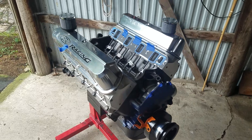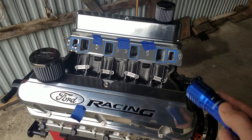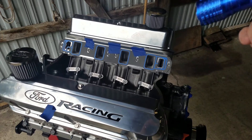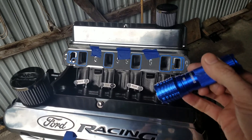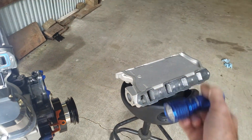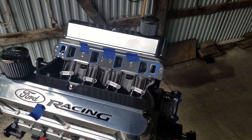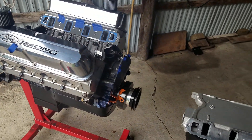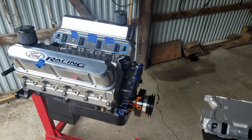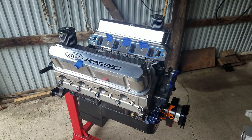You can port match your intake manifold so it matches your engine perfectly - you'll get more performance out of it and know you did it the right way. The only way you can do this better is by actually bolting the intake to your heads, putting it on a flow bench, and using those numbers to open it up and work the areas that need improvement. But this is the best thing you can do in your garage to get max performance. Remember to like, share, subscribe, ring the bell - keep wrenching, keep having fun, keep working on your hot rods.